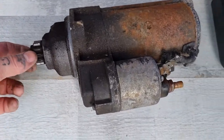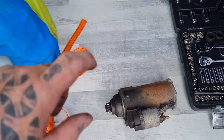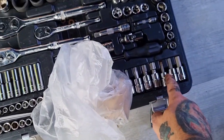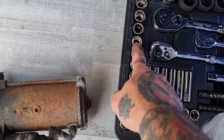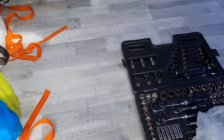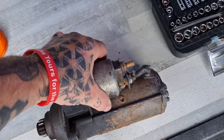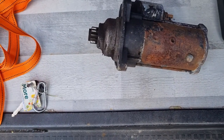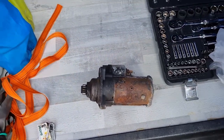That's the old one — they are prone to go. What was happening was when I turned the key it was just clicking every now and again, and I'd have to keep turning the key to get it to fire over. All I used was a 6 mil Allen head, a 10 mil socket for the battery, and a 13 mil for the power lead, plus a couple of extension bars just to get in. Hope that helps — it really is that easy. You can see this one is starting to fray; it could probably be reconditioned, but I'll chuck it in a box and keep it as a spare.